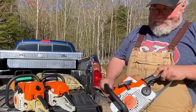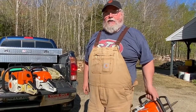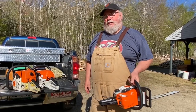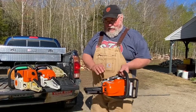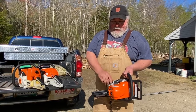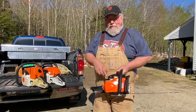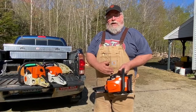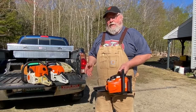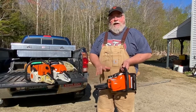Now this is just a small saw, great saw for a homeowner, but it gets left outside a lot. I'm probably shooting myself in the foot here because I haven't started this saw in quite a while, and it's been left outside in the rain and the heat and everything else. I see a lot of people complaining about their Stihls flooding on cold start. Some of that can be because the tank has built up pressure. You want to be really careful — a lot of times these things will build pressure up in the fuel tank, and as soon as you go to crank it over, the pulse line will send that little bit of pressure to the carburetor and open that diaphragm, and it's gonna squirt that pressurized gas right into your motor and flood your saw. It's actually kind of unsafe because it can blow gas all over yourself. Always check that first, especially if the saw has been out in the hot sun. So now we know that isn't a problem with this saw.